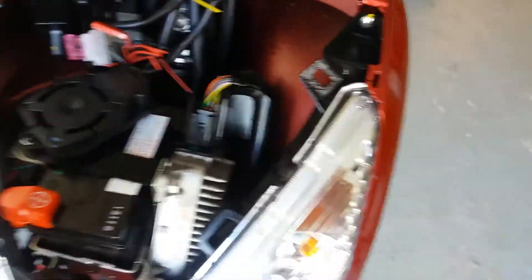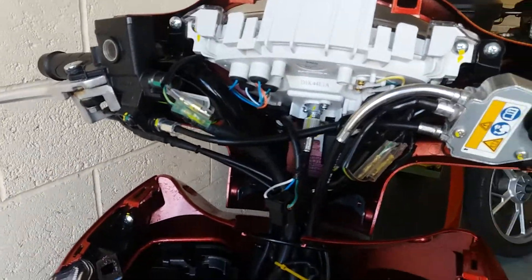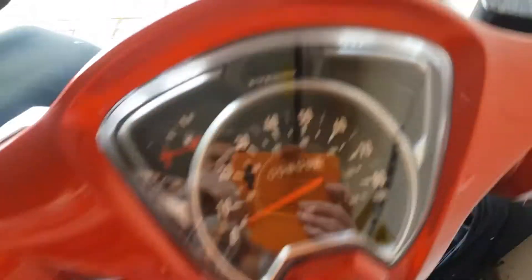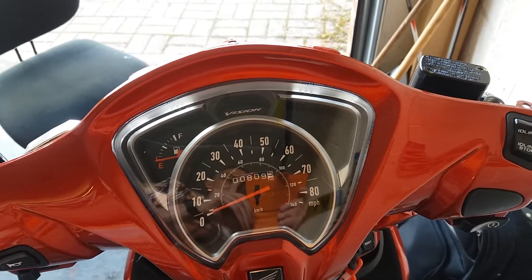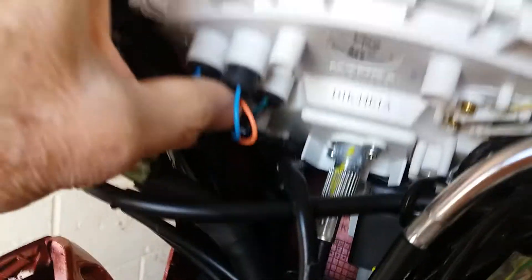You also need to remove the front center panel. The other reason I wanted to do this was because I'm not very happy with the indicator telltale - I find it very dim and quite difficult to see, especially when you have sunlight on it. The bulb is a T10 158, an ordinary filament type. I'm going to replace it with an LED version I've ordered off eBay, and when I fit that I'll do another video showing if there's any improvement.